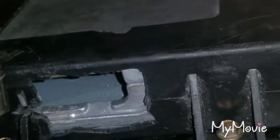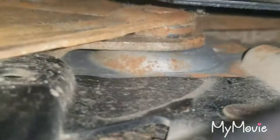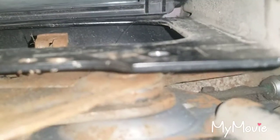They shouldn't be very tight. Then what we want to do is pull off to the side a little bit, then straight back. I kind of wiggle it a little bit sometimes. You can see way back there — those two little clips. It pops out and just catches on there so you don't break that. But I've got the PCM out now.